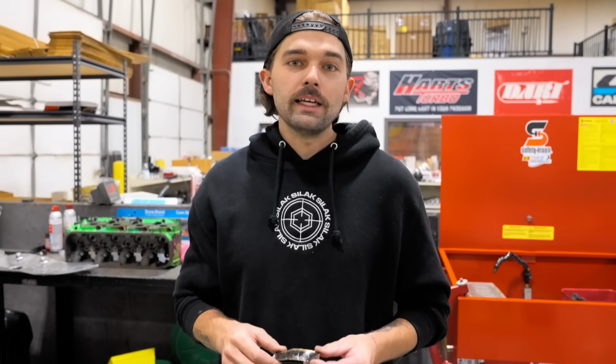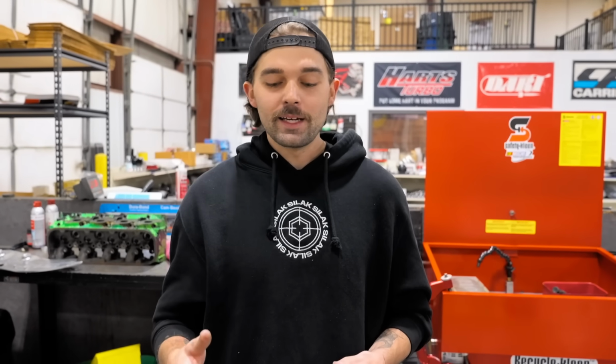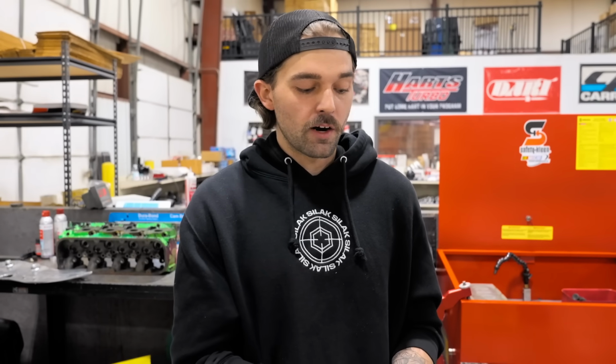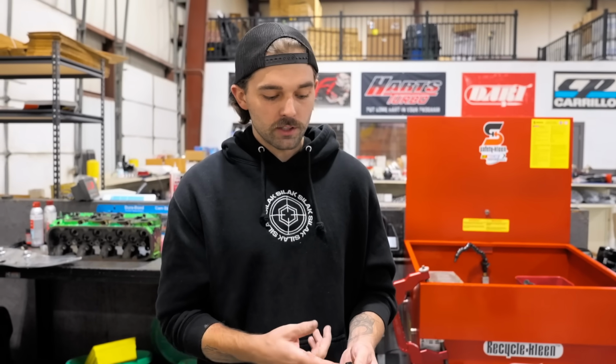In fact, I actually just had another customer of ours that had kicked the rods out of his engine the weekend after I did mine, Scott Oshinsky. He brought his broken stuff in here and showed it to me. And his is a perfect example of what happens when a rod physically breaks. It doesn't have an oil pressure issue. It has a rod issue. So Scott actually physically broke his rods, and his bearings don't look like this. They're completely messed up and flattened out and whatever, just like this one.